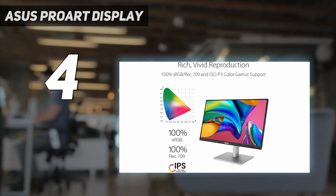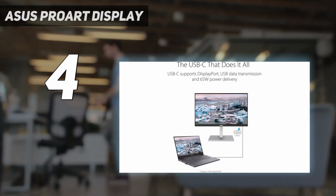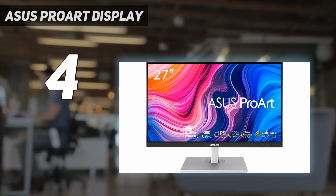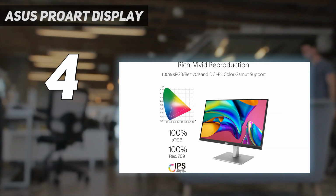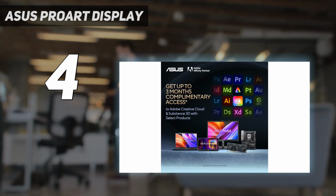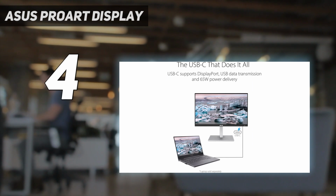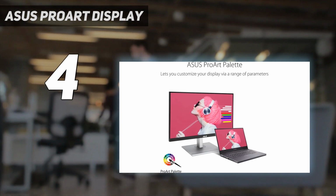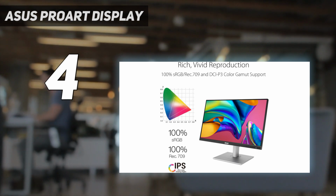It even supports daisy chaining through a DisplayPort output, which is great if you want to connect a second monitor directly. It has a few extra features, like a virtual grid alignment that makes it easier to align the monitor next to another display. It has a USB hub with 4 USB ports and an additional USB-C port that supports DisplayPort Alt mode with 65W of power delivery, so you can easily connect to a laptop. If you don't need all these features, consider the cheaper ASUS ProArt display PA278QV, which doesn't have a USB-C input or a DisplayPort output but performs similarly.